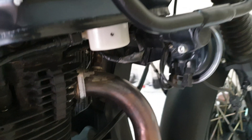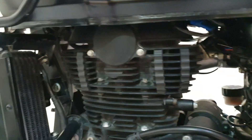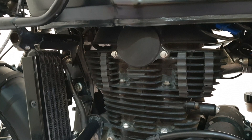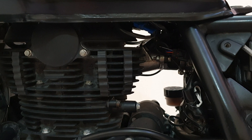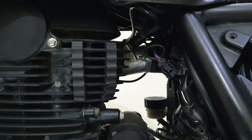Then of course there is the O2 sensor on the exhaust, temperature sensors, and an ambient temperature sensor inside the airbox as well. They are all giving feedback to the ECU — the ECU is right here — and it is working with less data technically. Only the TPS is not giving out information at that point, but the rest of the sensors are giving some data, so it will somehow manage to lug along.